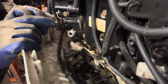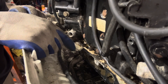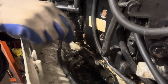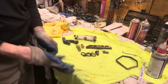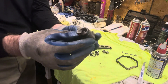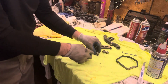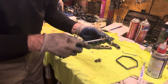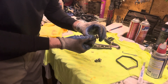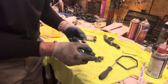We're going to strip the gaskets off and take a look at those on the workbench. We'll clean up where our hoses connect and probably run some salt-away through this once we get the new thermostats in — just not a bad idea to clean it up. The threaded holes were fine, and I'm glad to see that. We'll lubricate that and let it sit. We probably won't be able to get a tap in here because it's too small, but I'll slice a notch in a bolt and run it in there to help clean out the passageways. Here's what we ended up with: the hoses are pretty clean, they have some corrosion. Clamps are all in good shape — we'll reuse them. Our thermostats, as you can see, are all plugged up and it looks like sand is in there — someone got in the shallows.